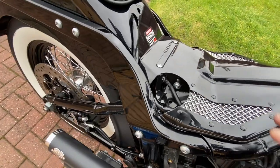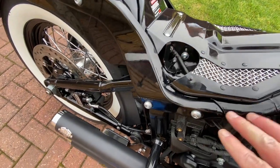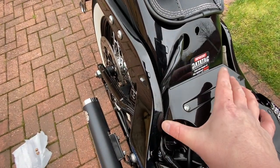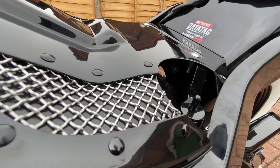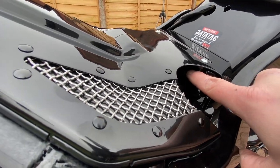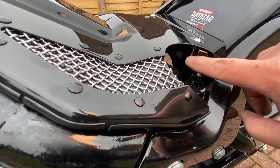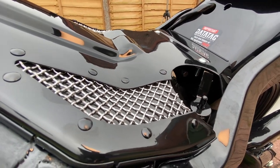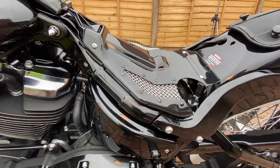Didn't have to relocate the reservoir. You can see the banjo bolt going into the reservoir just behind there, and the rear fender is bolted on. You might have been able to squeeze the brackets past without unbolting, but I tried to make it as easy for myself as I could. You can just see the bolt in there — which is for increasing your preload. I may have a go and see how awkward it is to adjust the preload if I'm carrying a pillion. But there's the base plate on.